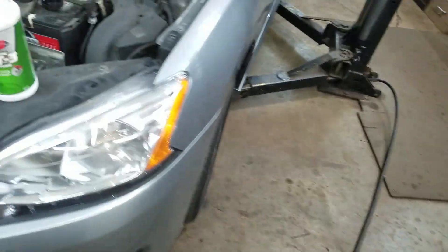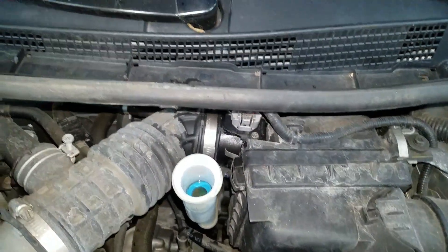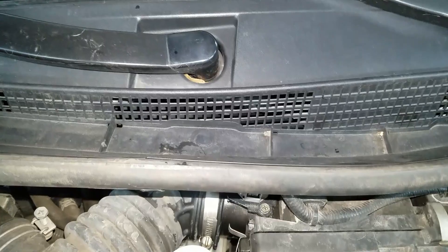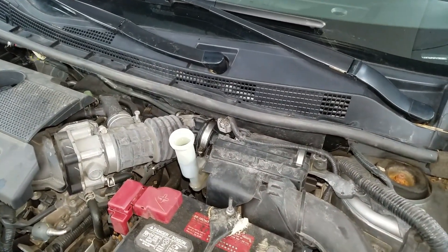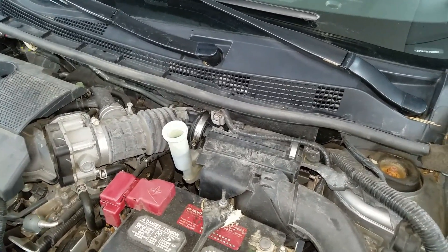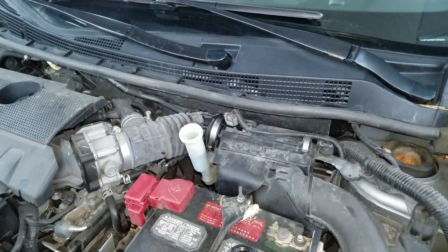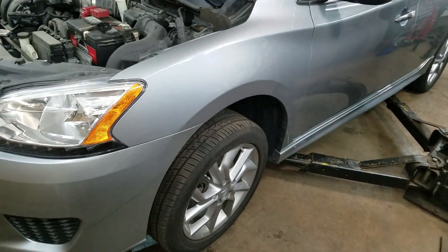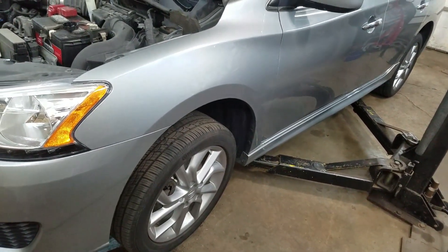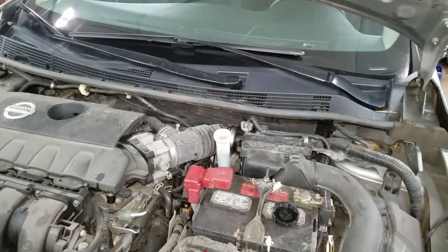Just like the front, make sure the caliper slides really nice and the pads move in there really good. I got the tires on — torque them to about 83 foot-pounds. I've never had a car gravity bleed so fast in my life — it sucked up a 32-ounce bottle in no time. I'm pretty sure I can just top it off — fill it all the way to the top. Since I did all four brakes and all of the calipers are unloaded, when I pump the pedal up this level should be right down at the full mark. I'm just gonna pump the pedal until it's nice and solid, and then I'm gonna bed the pads in. You just do 30 miles an hour, come to a slow stop a couple of times, then go down a freeway and hit the brakes. And they should be bedded — this should be a brake job.